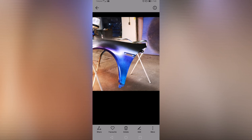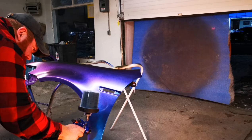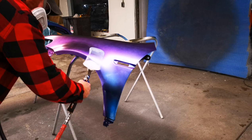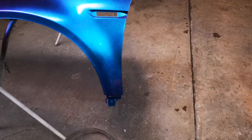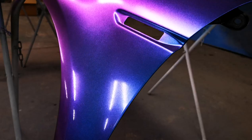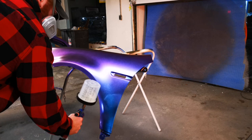I'm actually super happy this happened on camera. You guys can see, if you look really closely, the bottom of that fender — I messed up really bad. There was a little bit of solvent in the air cap of my gun and it splattered on there. How you fix this is you go back to black: dust a little bit of black over the area you messed up, then go back to chameleon and basically fan it out over the area and blend it in like you would a regular base coat. And as you guys can see — wow — fixed that mid-job. I've done this a couple times, but I can't even tell where I started and stopped the paint.